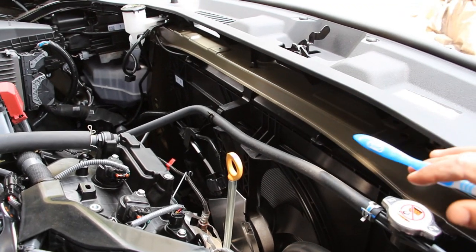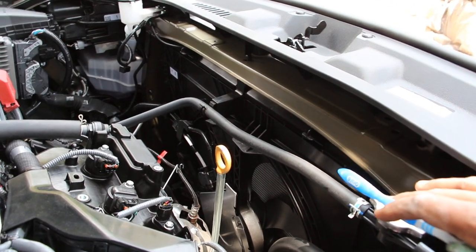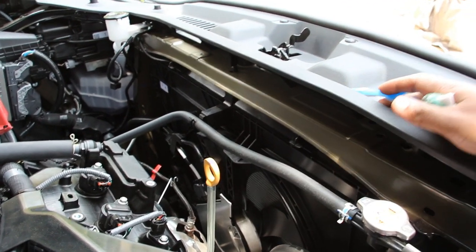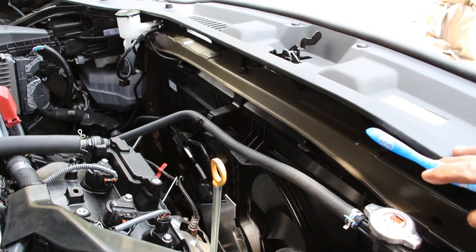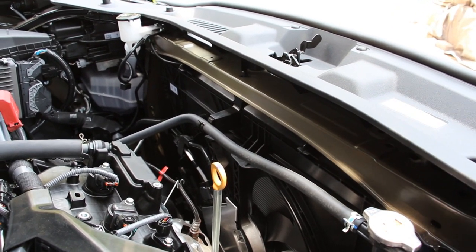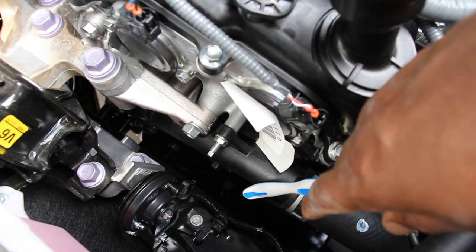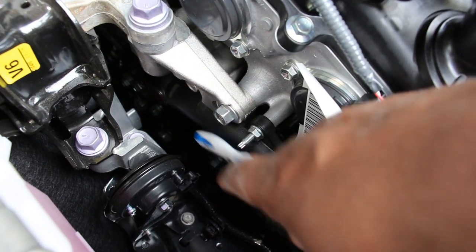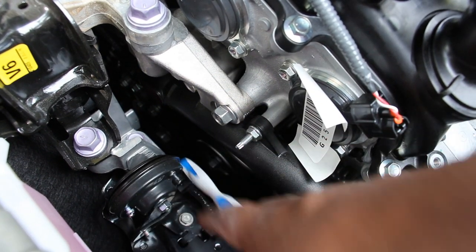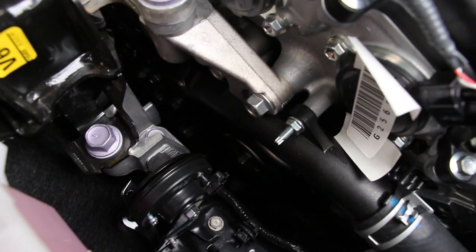Next we're going to take a look at the cooling system on the Toyota Highlander — and this is where I think Toyota has really short-changed those who have to do maintenance here. For example, if you want to access the radiator, which is buried down inside of here, you have to remove the entire front end of this vehicle including the bumper skin and bumper support in order to get the radiator, condenser, or fan assembly out. Coming from the radiator you've got this lower radiator hose that goes into this plastic assembly here — this entire assembly is the thermostat. There's no separate thermostat like in older vehicles, and in order to access it you need to get in behind here to access some of those bolts. The first step in Toyota's book to remove this is actually to remove the entire transaxle assembly from the vehicle just because you don't have enough space.